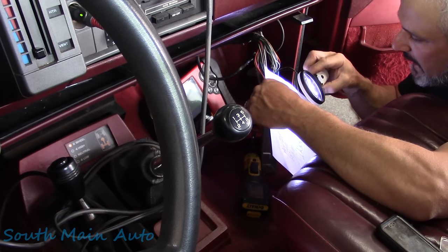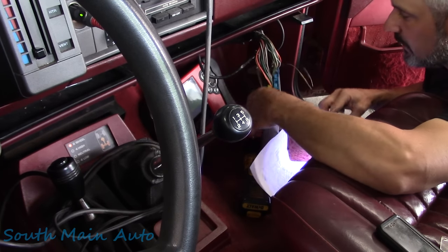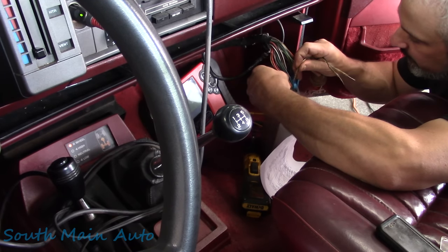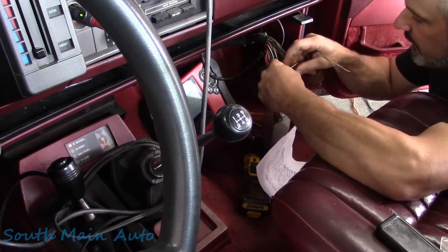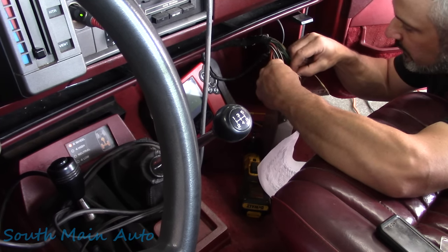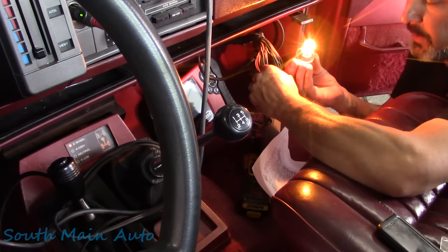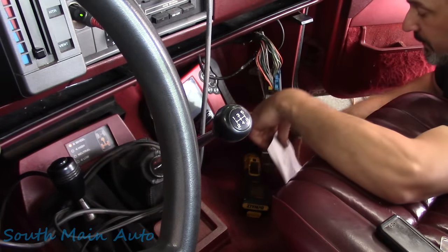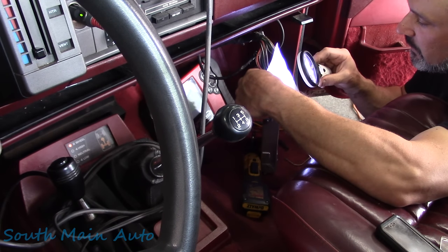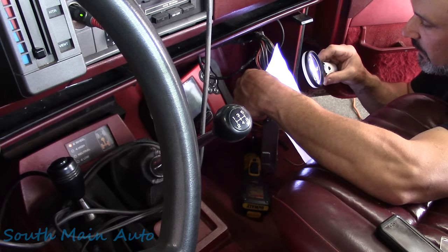And then we do have another battery, which is orange on B1, which is gonna be this little fella right here. And then we'll go back to that ground that we just checked. We know it's good. If I can find it. And there it is, and we have a nice bright light. So it appears that we have all of our powers and grounds, and then we have a memory power, which I don't think we're super concerned with.